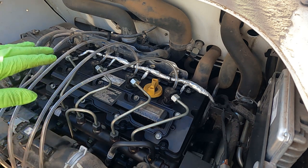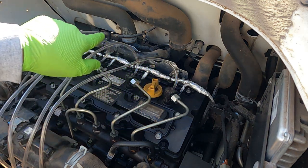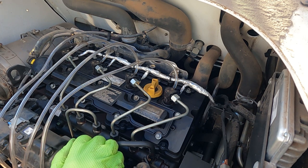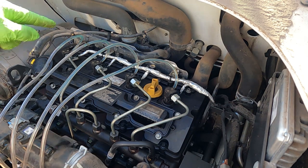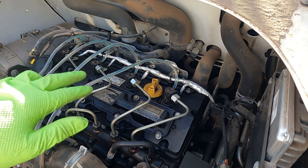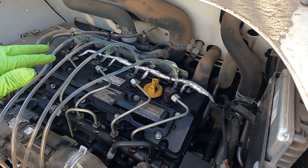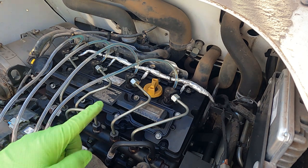I've got all four of my lines hooked up to the injectors. I'm going to turn the engine over and watch these tubes to see how much diesel is coming back through them. Looking at injectors number one, two, three, and four — injector number two is definitely leaking more than the rest. One and two both failed the static test because they leaked so much. Three and four are questionable. I would almost say this system needs a whole entire fuel system replacement, but I'm going to see if I can get it started by blocking off number two.